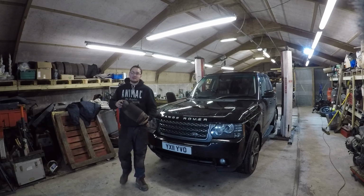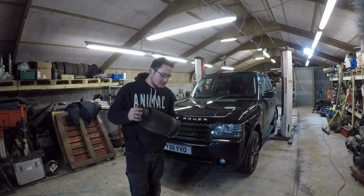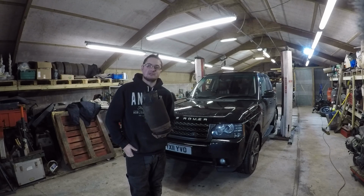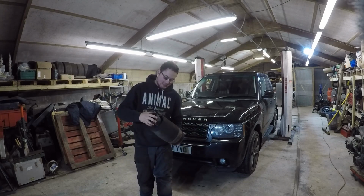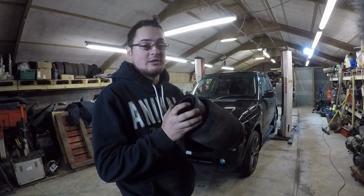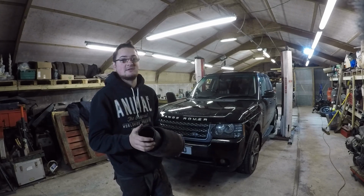And I can't remember if I mentioned in the first video, but I had airbag issues at the front. Sure enough, within 2 days of actually using the car, the front corner was down and then the whole car was down its ass and I was driving on the bump stops. That was due to this front airbag being all perished and cracked. So I do need to check out the offside as well, because there's a chance that airbag is also knackered if it's original.